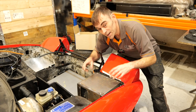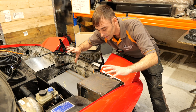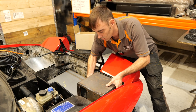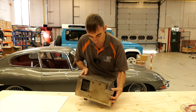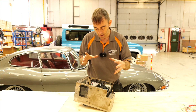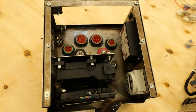Now you've seen lots of orange high voltage cable around, but you're probably wondering where all the low voltage control cabling is going. Well, that's what this box is here. What we've done is cleverly got all of the low voltage coming into one junction box — this one — and it just sits taking up this little bit of space. I'm going to take it out, bring it to the bench, and show you what goes into an innocent looking box like this. It's a fabrication marvel as well as an electrical marvel — so small and fiddly, but once it's compact and done right, it's such a space-saving solution for our conversions.